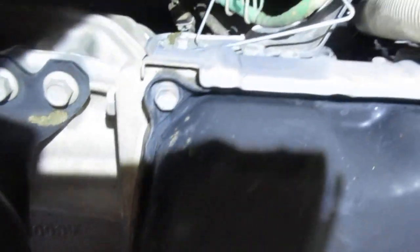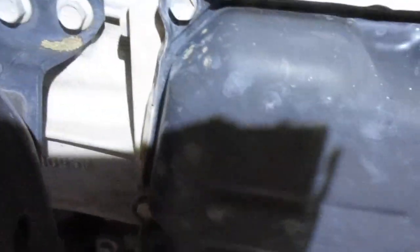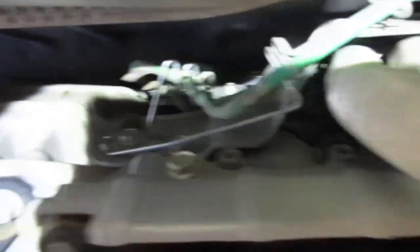What we'll do is shut the engine off, and then we'll remove this plug to drain it. Then we'll leave that one off and fill it up on the side up here. It's kind of hard to see it, but right there where my finger is, there's a fill plug that you take off. It takes a 15/16 socket to take it off.